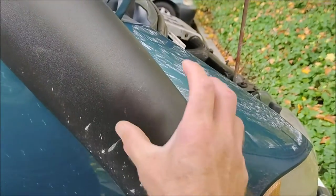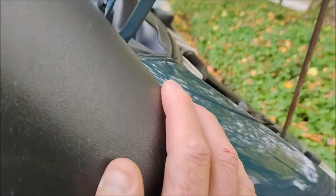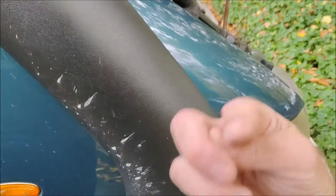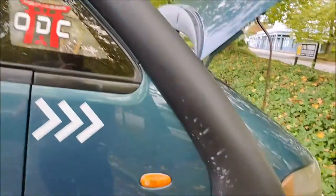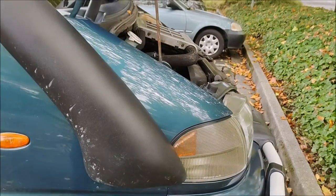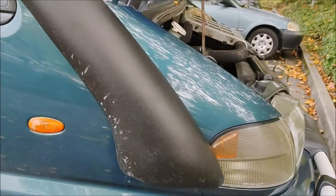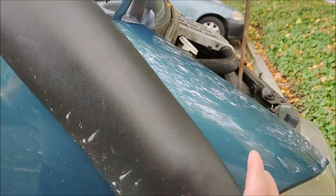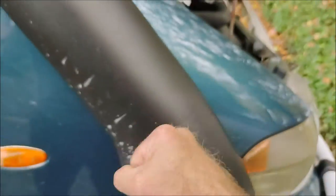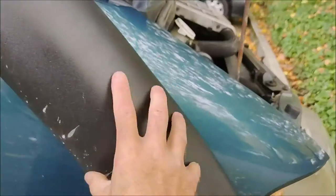Now on the back of the snorkel itself, there were probably four mounting points where there is a threaded nut molded into the plastic, and then with the kit came about four 40 millimeter threaded rods that thread in, go through the holes in the body, and then have nuts on the inside that also came with the kit. Without the pattern — which is supposed to be a piece of paper that you lay out corresponding with different places to let you know where to mark things out beforehand — it would have been helpful. Without that, I had to get creative. I took the threaded rods, threaded them into the receivers on the snorkel itself, lined up the hole, lined up the angle of the snorkel where I thought it should be, pressed it on the fender, and gave it a good whack — one, two, three, four — to mark the fender where I would drill them.